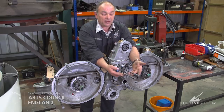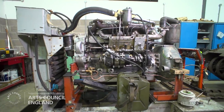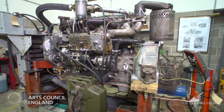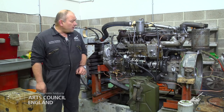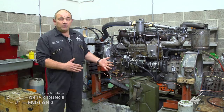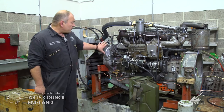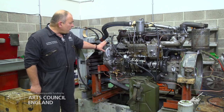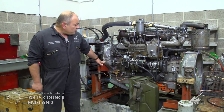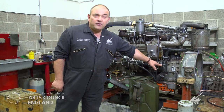There's a twin linkage here that runs off the fuel injection pumps. Les is going to talk about the actual building of the engine and the block, and I just want to run through some of the ancillaries that we've been putting together while he's been building the main thing. Some of them you'll recognise from earlier. We've got the timing case on the end here — that feeds the fuel injection pump. There's also another drive coming off the timing case that feeds the dynamo, and off of that is another drive that feeds the water pump.